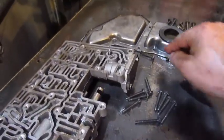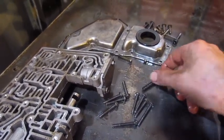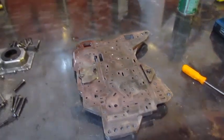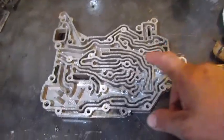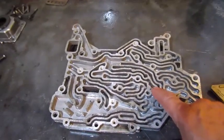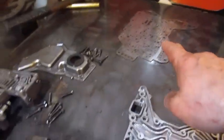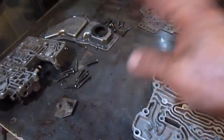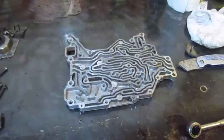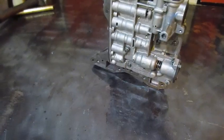Those balls are the same, so you can interchange them. And I guess the earlier models use the ball for this instead of a hat. So we're going to open this up and I'll get it cleaned out, and then I'll get the valve body all put back together. Okay, I got all the valve body cleaned up and ready to put back together. That kind of sucked. This gasket was like baked on there. So put the gasket in, metal plate, valve body that's been cleaned, filter, all the bolts, and next video you'll see it put together.